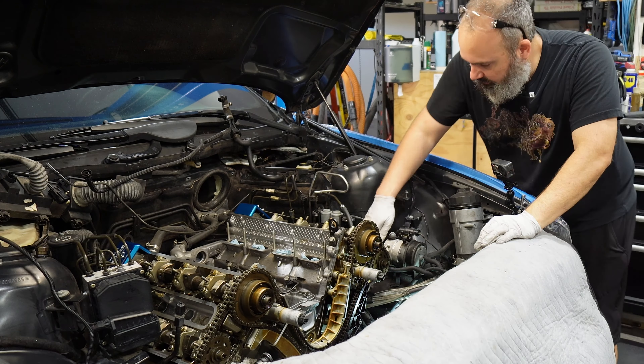Before you drop the subframe, disconnect your headlight leveling harness up front here — otherwise you'll wind up breaking that. The headlight level bracket is attached to the subframe, so we're solid there — and there we go. In the back of the pan you can see all that goo, which I'm guessing was at some point a coolant leak out of the valley pan that runs back out of the drain.